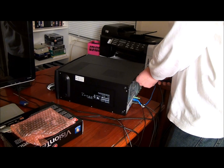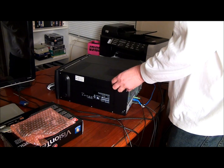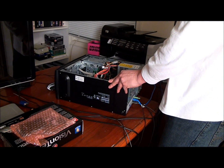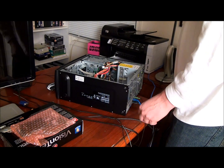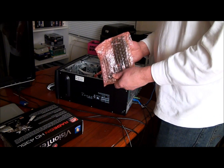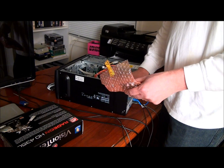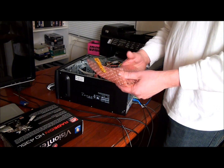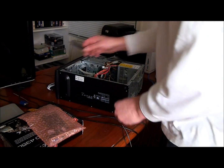Installing a new video card — that's the first thing we need to do. Not a very difficult thing to do, not very time consuming. You might just need a screwdriver. One of the things we want to do before we get in there is unplug the computer, but go ahead and leave everything else plugged in — we're just unplugging the power. When I pull the video card out of the static protection, I want to make sure I'm in constant contact with the case so that I don't give the part a static jolt.